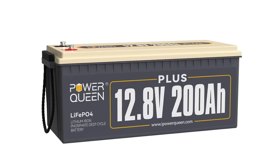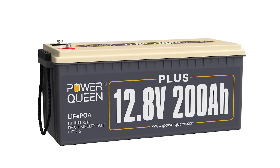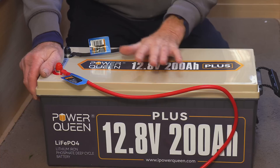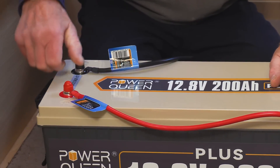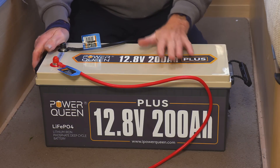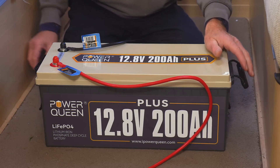This is a lithium ion battery with phosphate technology, which means it works in a slightly different way to the cheaper lithium ion batteries. Before using it, you should charge it up separately — off the vehicle — make sure it's fully charged, and leave it on for several hours to get a full charge. Then when you've done that you can connect it up for use, but don't connect it up for use and then whack the charger on it and expect that to do the job.